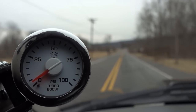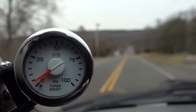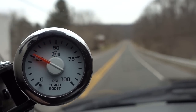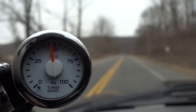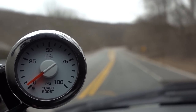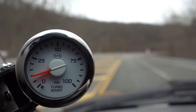I should mention: if you had a bigger fuel system, this turbo would perform even faster. We're going to do a fifth and sixth gear pull at wide open throttle. We're not hitting really super high crazy boost numbers with this thing because we're on a stock fuel system, but 50 pounds is still pretty good for a completely stock truck with a 67-millimeter S400 turbo on it.